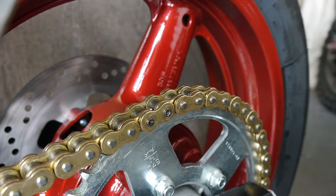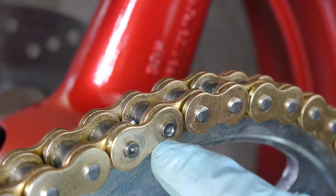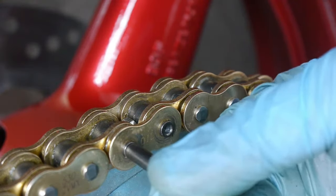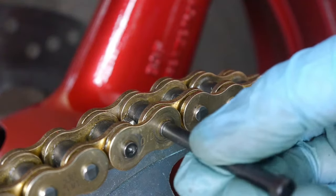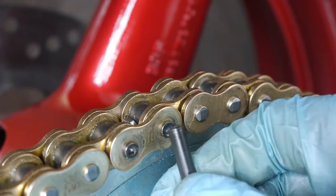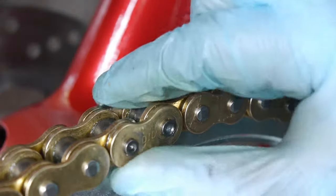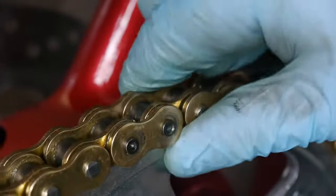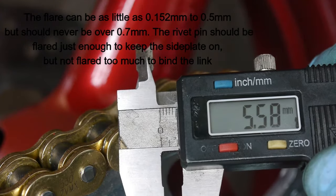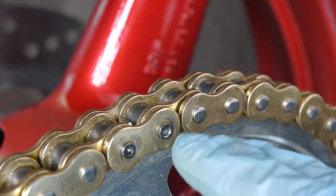The little dome — as you can probably see, this one is visibly larger, not by a massive amount but it is larger than the original. Especially looking at the center hole: on the original pin the tool wobbles about on the dome, but on the one that's finished that is a nice flat finish. That's the limit of the pin whenever it bottoms out on that little dome — so that's how you know it's done. Simply do the other one and check that both links are nice and free. My pin ended up expanding from around 5.34 millimeters up to 5.58 millimeters. After a short run, just take a look at the links to make sure everything looks fine with the rivets — and that's pretty much job done.